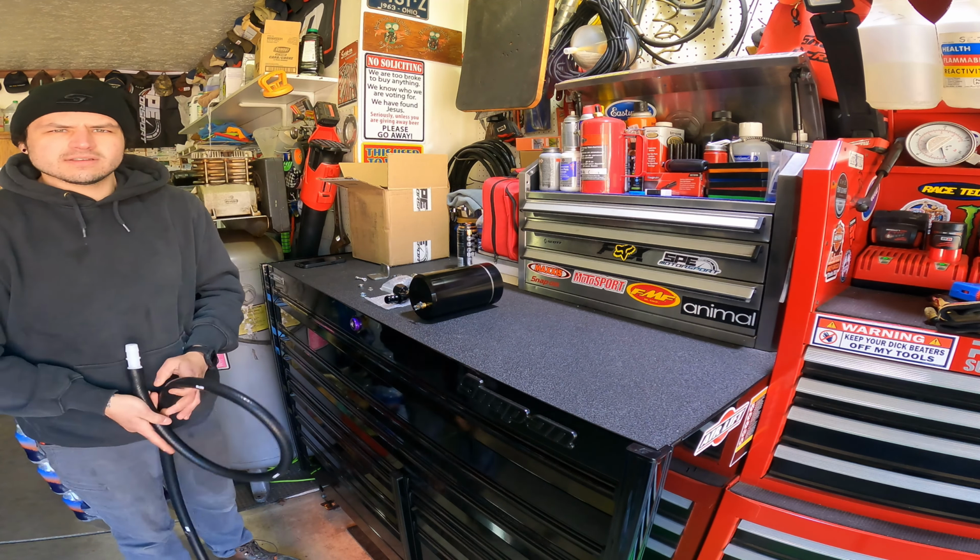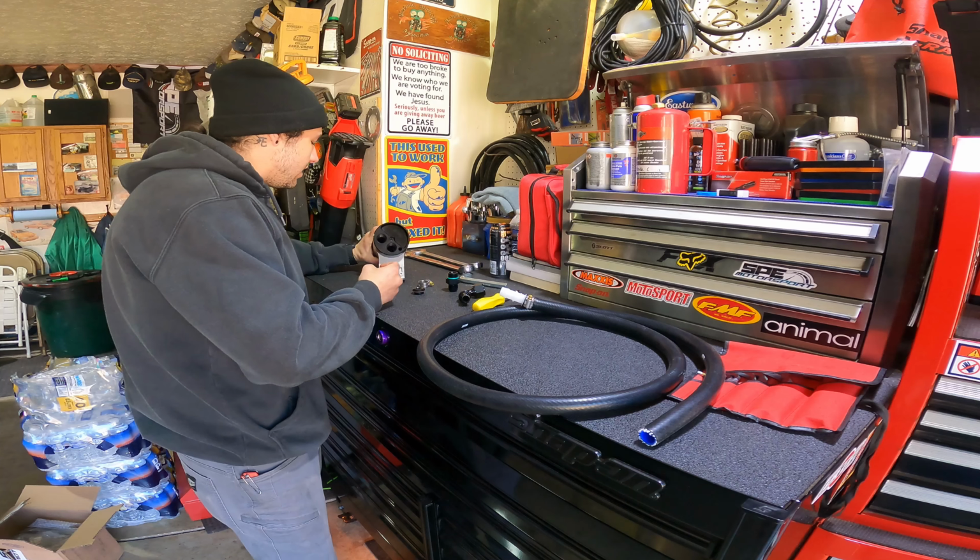All right, y'all. Real quick. So, barb fitting. You got a 5/16 nut driver or a socket you could use. That's on. Catch can. So you got your bracket right here. It's slotted. I kind of just left this stuff in loose right now, depending on where we want it. You got your nut. We're going to use one of the factory studs wherever we mount it.